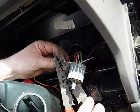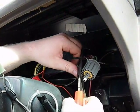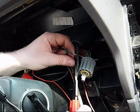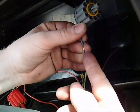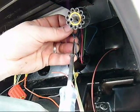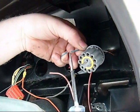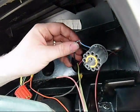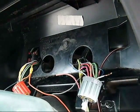I'm gonna choose my size here — in this case it's the 10, just whatever fits the best. And instead of cutting the wire, I'm just gonna try to yank on the wire. Basically, if you can see it hopefully, I've pulled some of the insulation away to expose the wire. And then, instead of just wrapping it around it — which can come loose over time — I'm going to poke the test light through the wire, which gives me a nice little hole right in the middle that I can feed my continuous power wire through.